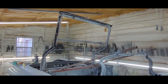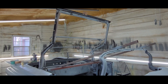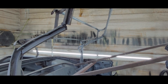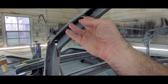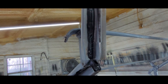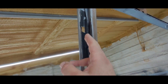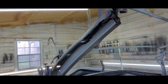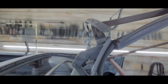Today is Thursday, March 9th, 2023, about six in the evening. I finished up for the afternoon — what I did today was sand down the top rack. I got all the factory sealant off. I don't know exactly what it's called, but it's what the factory used around windshields and it never dries. It's equivalent to 3M bedding and glazing, and it was all caked on up under the roof rail where the strip goes. I got that all down, and once you get most of it off, the wax and grease remover solvent really cleaned it up.